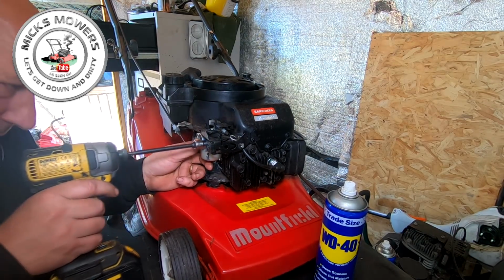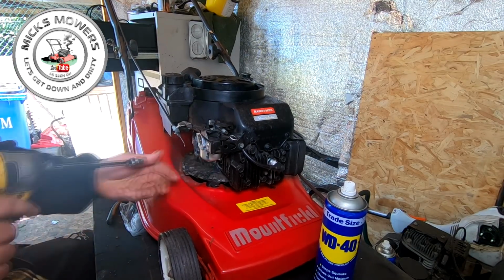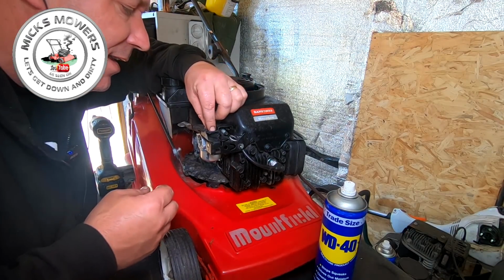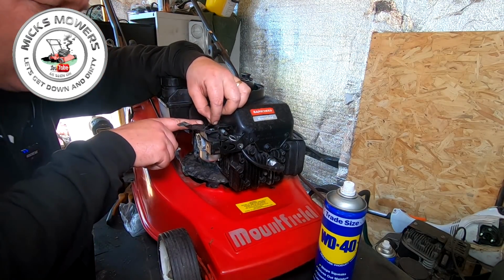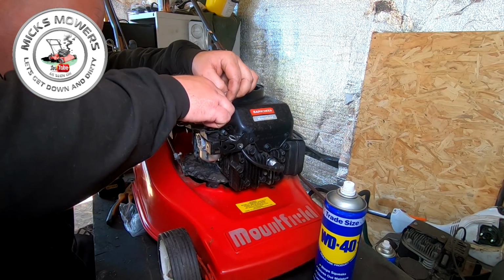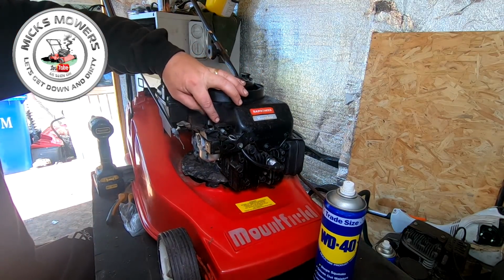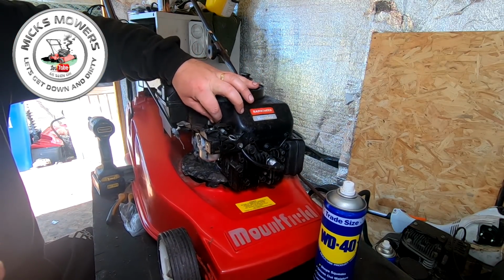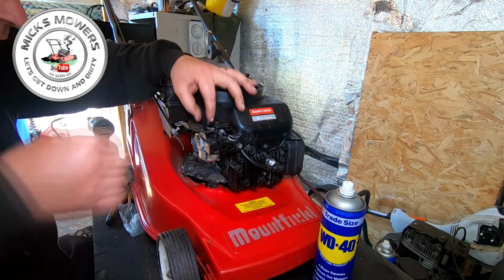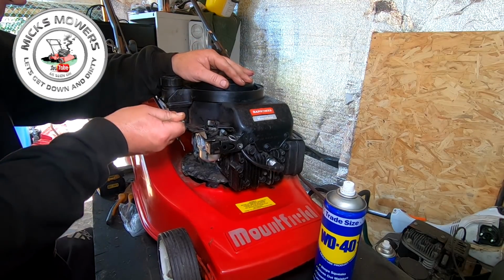Right, that's the first bolt in. That's the second bolt in. So that's all on. You've got a little tiny black spring here, and it is tiddly, and it sits on the back side of this little tiny choke flap. If it's not on, your machine won't choke later on. So make sure that's in place. So that spring's in place as it should be. That all works. Yeah, that's all free to move. My choke will move as and when I call for choke. It'll choke itself and come off.